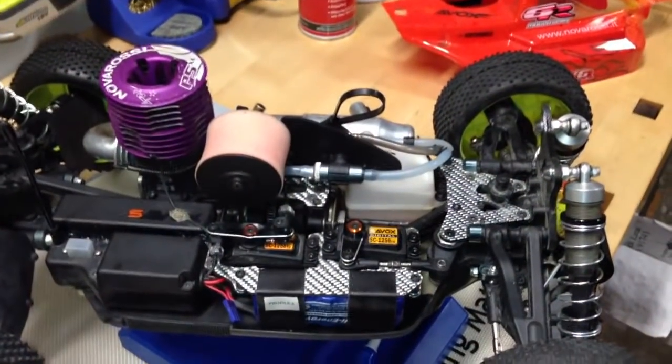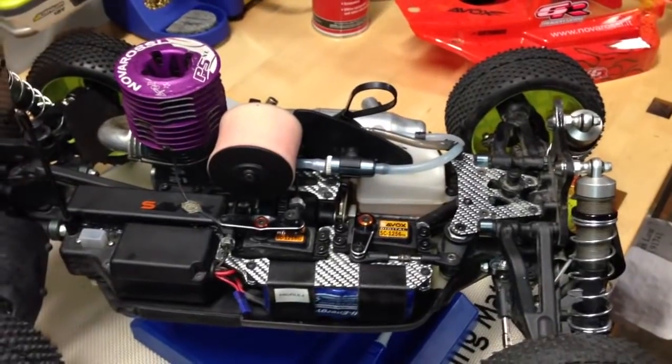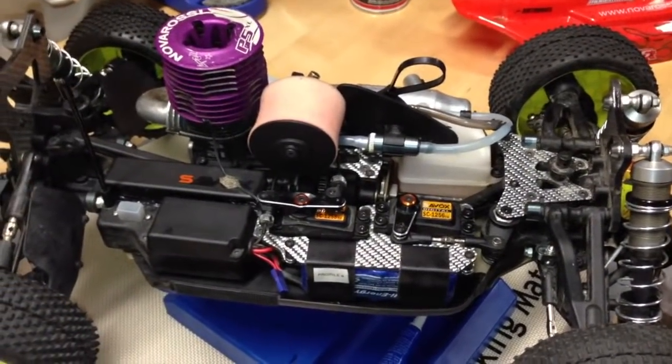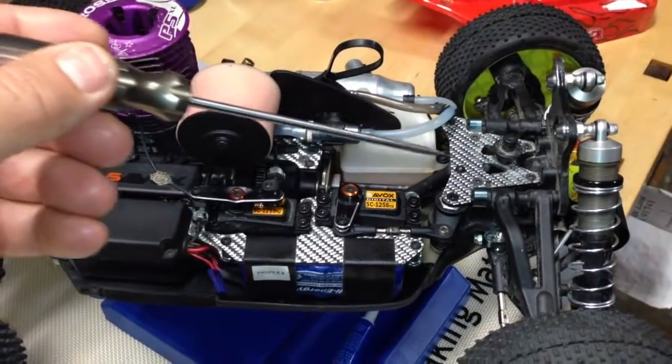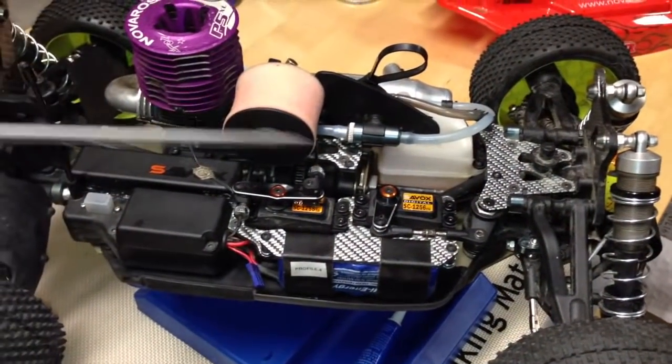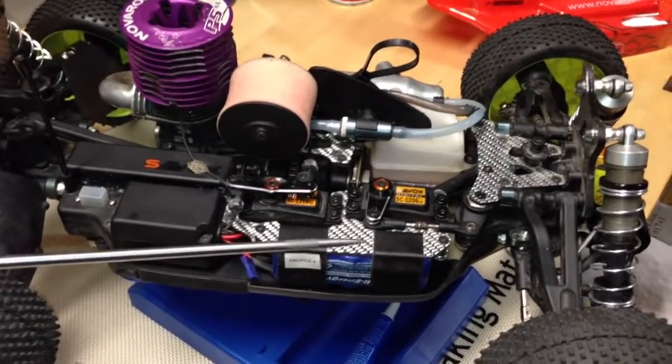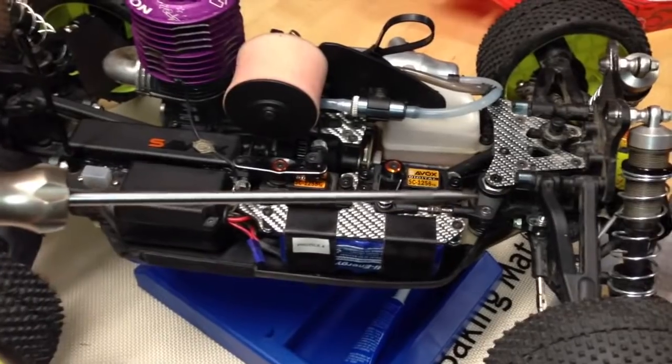Now the bonus section. Let me just blast through a couple things that I learned either during setup or predominantly out of the track. First of all, stem to stern, I would Loctite every metal on metal connection, case closed, whether the manual says to or not.